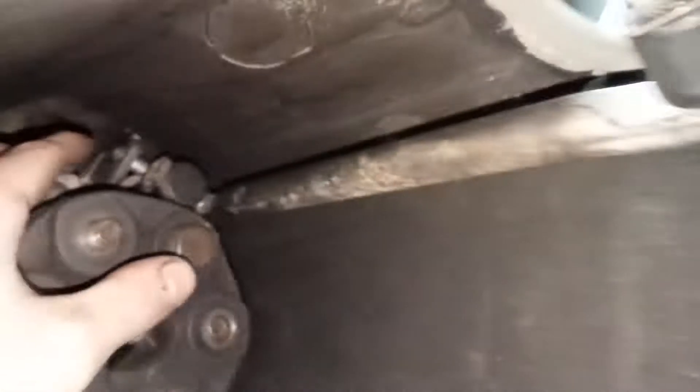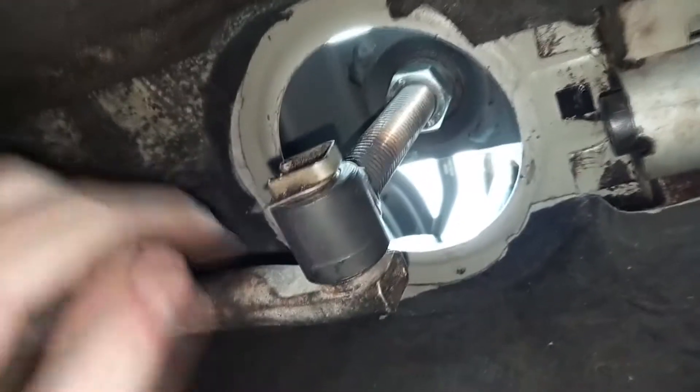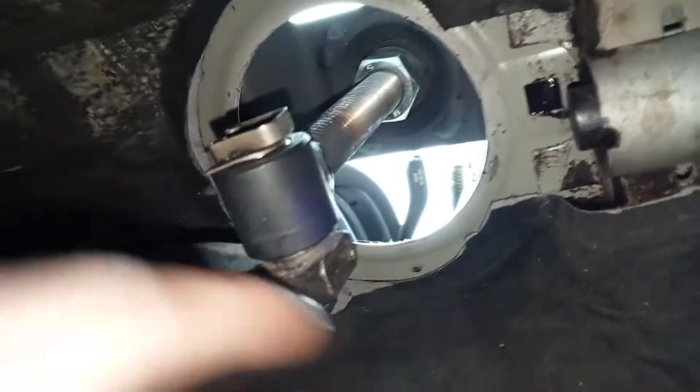This part's together now. To put this piece on the gearbox side — this is all connected up now. Like I said, this bit was push fit, this bit was like press fit, you probably could knock it in. This side just went in nice and easy, got both clips on. It's nice and solid even though it's not bolted to the car yet. All I'm going to do is mark it out, drill from the top down, and put washers underneath.